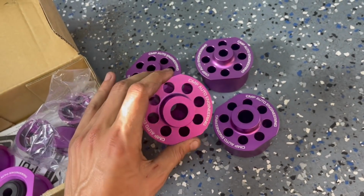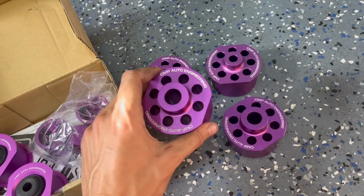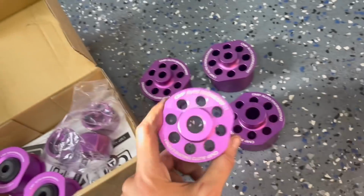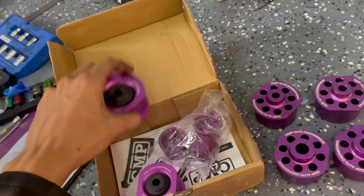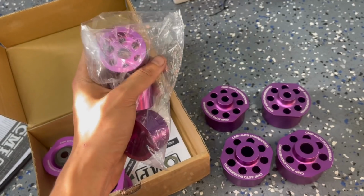So like when you have blown subframe bushings, it allows so much movement, which really doesn't help with the cracking issue. So when there's like a lot of movement, it really creates a lot more stress. So you'll definitely want to do these when you're doing the reinforcement job, and you might as well get these because these are going to really help with your handling. And you don't want to have stock diff bushings either, because these are usually the first to go out of all these bushings.